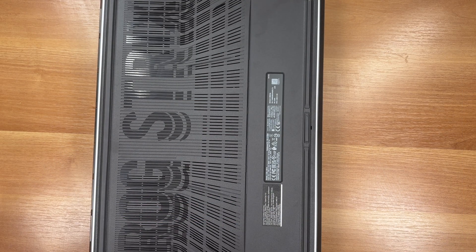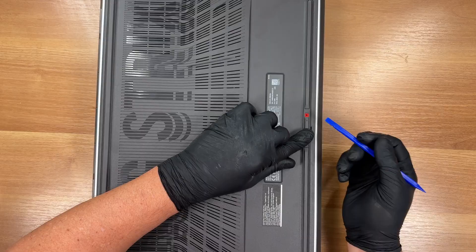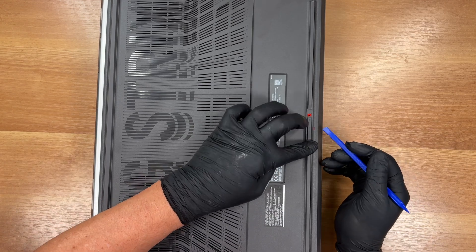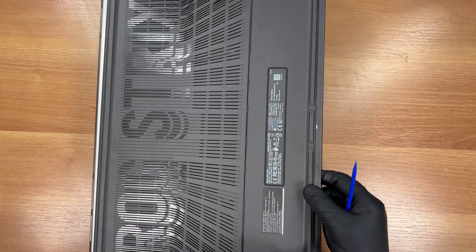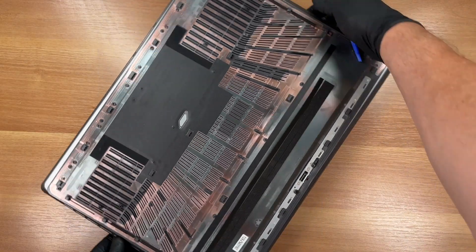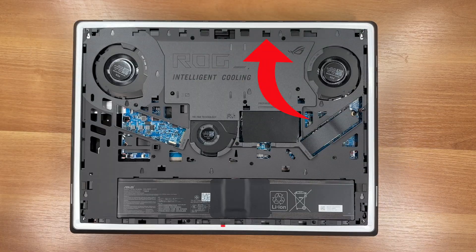The laptop has a rear cover with a Q-Latch mechanism and two status markers. The first marker is here — red means unlocked. To remove the cover, pull the slider, then push it to the right and the red color should appear in this window as well. Done! The chassis includes a safety switch hidden here that prevents the laptop from powering on while the bottom panel is off.